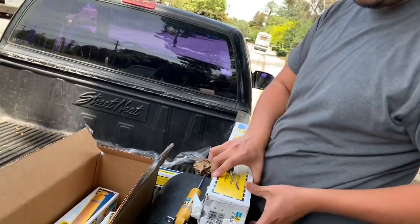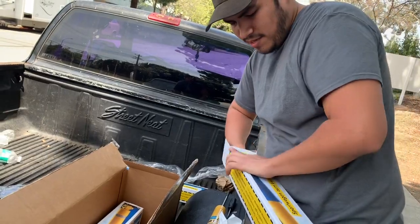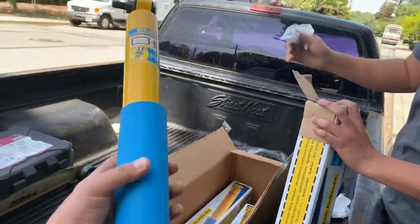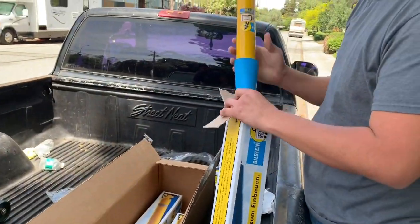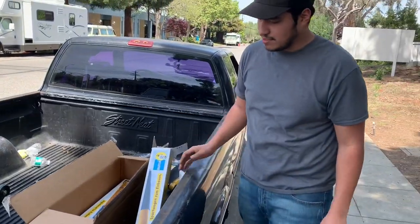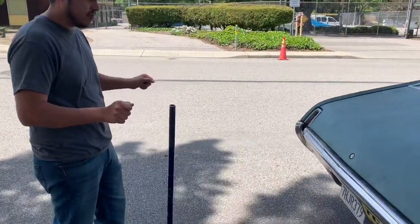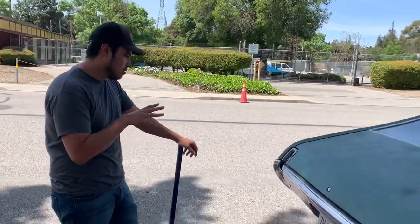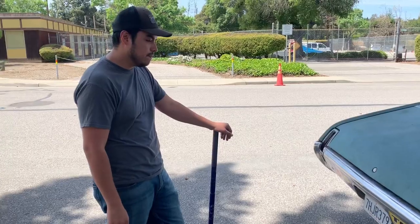Now, this should very much improve the riding situation with my car. What you need is a screwdriver to open your boxes. These are the back ones. It should definitely make a big difference on my car. I'm pretty sure the shocks on this thing haven't been changed in like 20 years. You never know with old cars — cars sit in people's garages for decades, somebody picks them up and starts daily driving them, they ride sketchy, and then you're like, okay, I need new shocks. We're going to lift the rear of the car, take out both old shocks, put the new ones in, bolt everything, drop the car, then move to the front. This should work for any old car — the suspensions are very similar. The basic idea of changing the shocks should be the same.